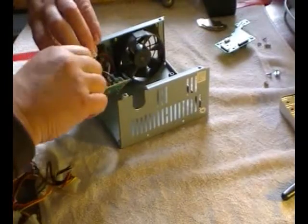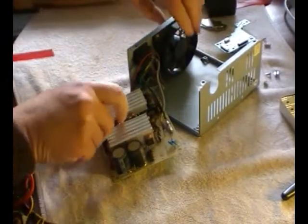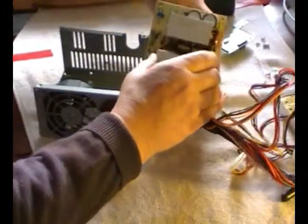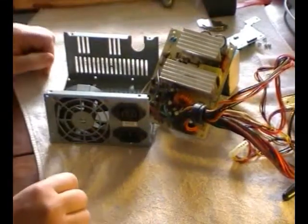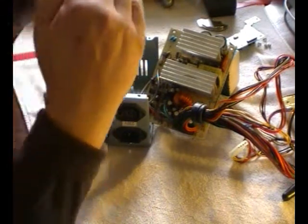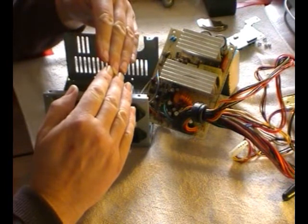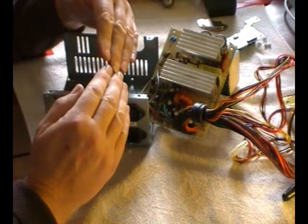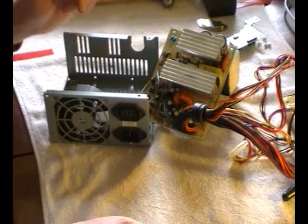Now we can pull the printed circuit board outside of the case, and what you do next is you look for any dodgy looking components, mainly capacitors that have gassed, and by gassed I mean the top of a capacitor is generally flat. When it gasses through an internal short circuit, the slits in the top of the capacitor are thin enough that the slightest bit of pressure makes them pop. And I have such a beastie on this power supply, and it's that one there.